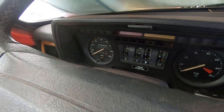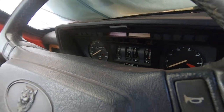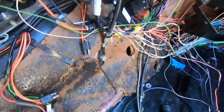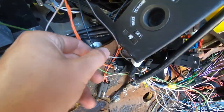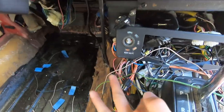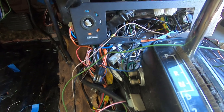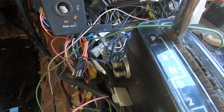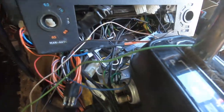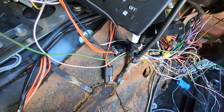This connector here connects the fuel pump power to the Jaguar harness — two orange wires going to the same thing to power our fuel pump. I did that because I didn't want the GM harness and the Jaguar harness to be one thing; I wanted this to be removable. If you remove the GM stuff, it comes out all together with a connector.